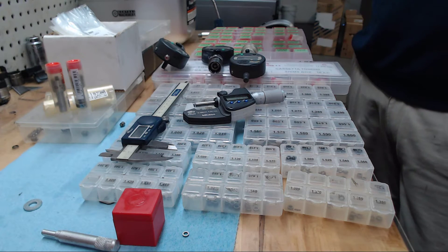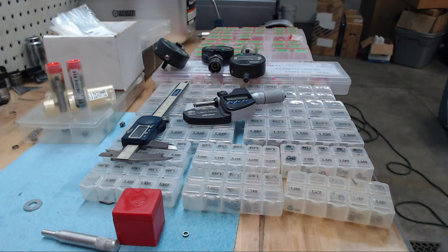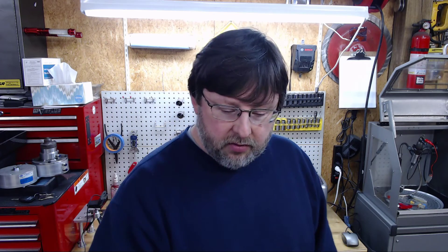We don't want to say it's impossible, and if you've got the means and think this is something you want to get into, we'd be inclined to help you. We're going to show a video of us going through one of these 5.9 injectors — maybe even an LB7. We'll show it failing on the bench, then go through the process: cleaning the parts, measuring, and rebuilding. We won't give you the specs, but we'll show you how it's done. Then we'll run it in the machine so you can see the before and after.